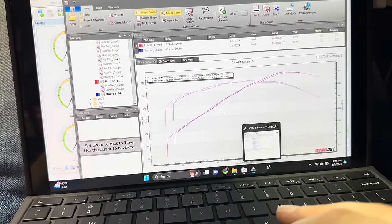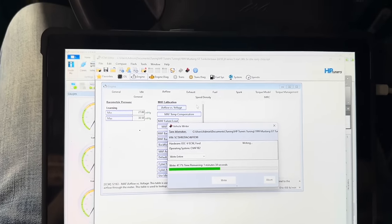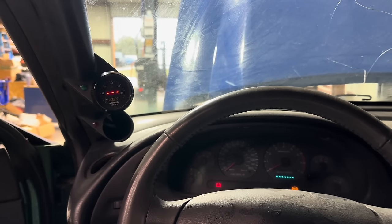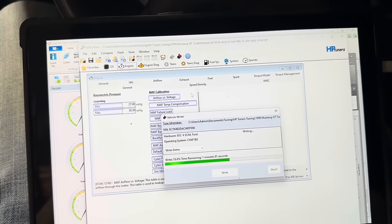And we're just running out of fuel. I'm still working on dialing in this MAF, but no matter how much math I throw at it on the top end, it doesn't seem to be really getting into that 12.3, 12.7 target. So more than likely, we're gonna have to do a fuel pump on the car.